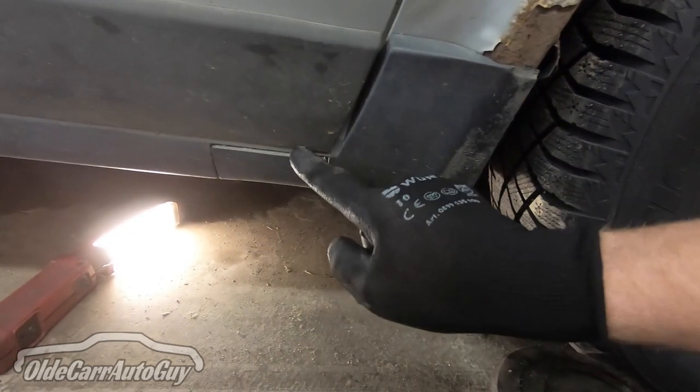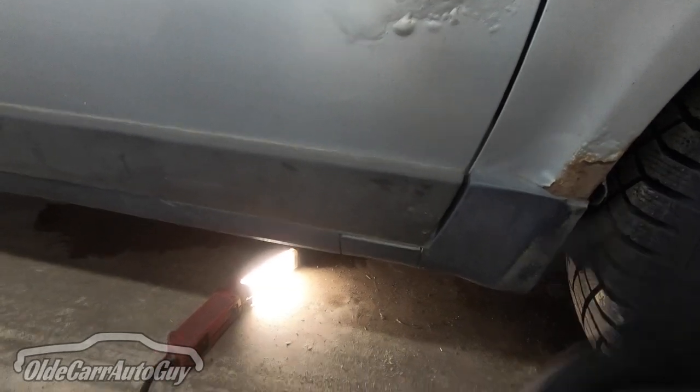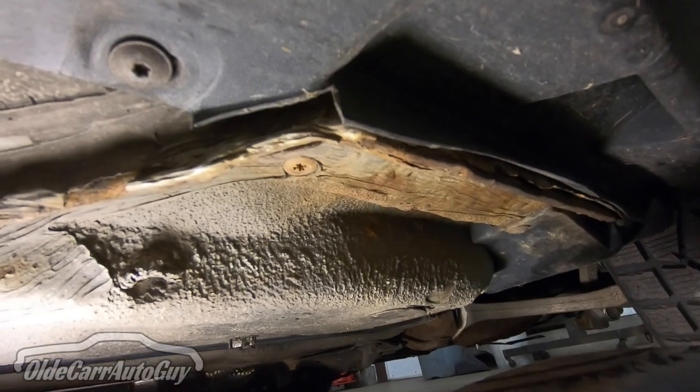One thing a lot of people don't understand is that when you get your car inspected — at least here in New Brunswick — your rocker panels have to be intact with no holes. That's where the structural integrity of your vehicle is, and that's where you should be lifting. Most vehicles have a designated spot to lift. On this Volkswagen you can see this little cut-out in the plastic molding — right directly under that is where the seam of the floor pan and the side body structure meet. That's where all the strength is, and that's where you put the pad of the hoist.